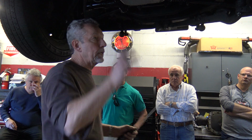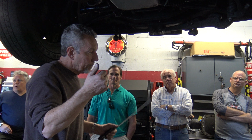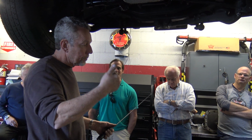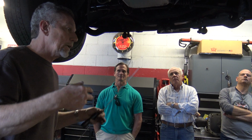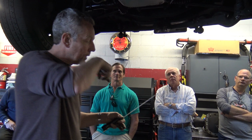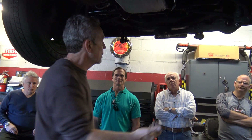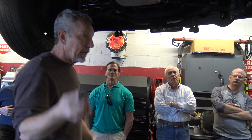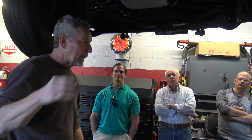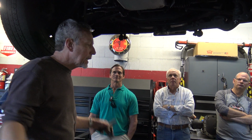So when you talk about the brake fluid cars as opposed to the mineral oil cars, the Corniche was the premier model. And then when they came out with the Camargue, which is another premier model, they came out in '75. The premier models always got the newest technology. That's what I'm trying to get to. Silver Shadow used brake fluid through 1980. Now the Corniche, they went to mineral oil in 1979. So they were the test mules, basically. The most expensive cars were the test mules.